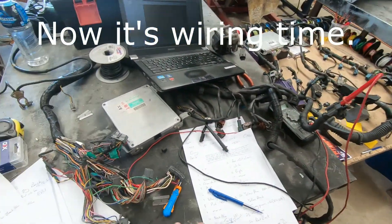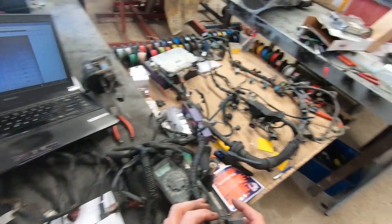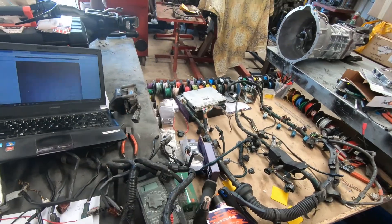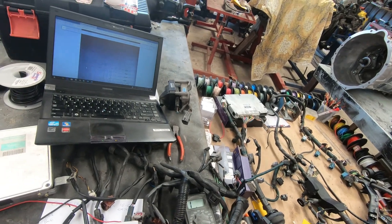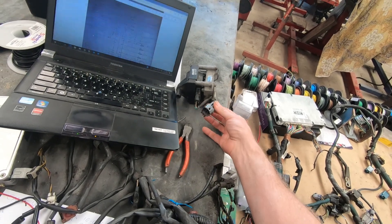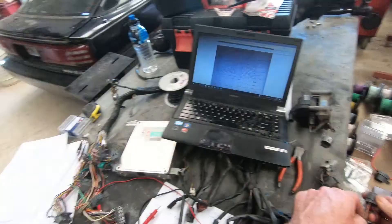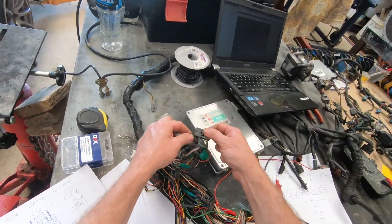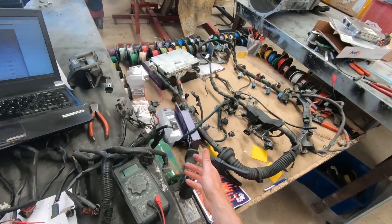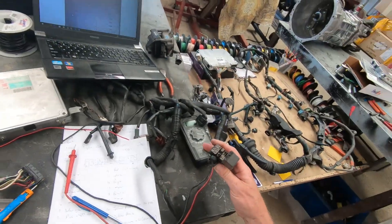So a little tip - when you're working through this wiring and you want to find the tacho wire in the diagnostic box of these older cars, we've got IG poking out here which generally has a black wire, and it will come from somewhere near the igniter. So here's your igniter - it's a black wire and this plug here. It also comes over to this mess over here - it's the black wire there. So when you're looking for that tacho wire, it's in that diagnostic box on the IG - IG negative.